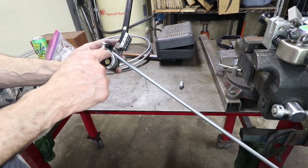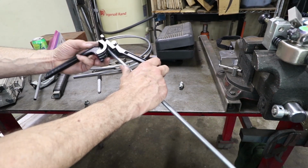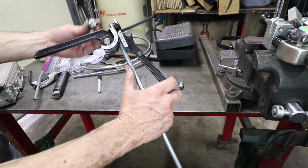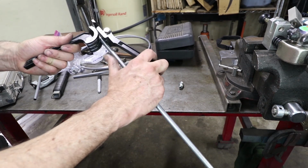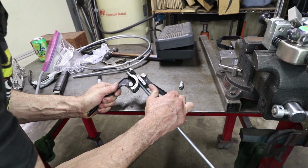My zero mark is lined up with these double zeros. So then this comes on top, and this is the tube sleeve right here. Now the tube nut, there's no space for the tube nut, but the tube nut actually has a thin diameter on it, so it can go around bends, but the tube sleeve has to be there before you bend it. So now it's just a matter of going to that first thing, like I said.